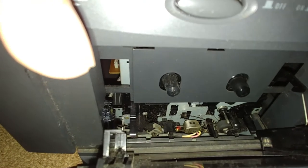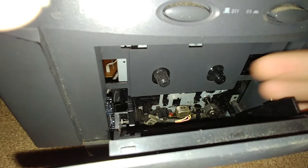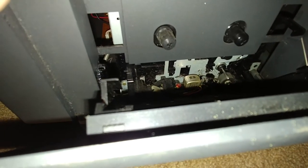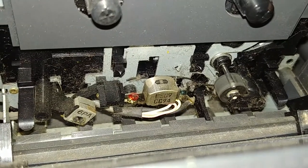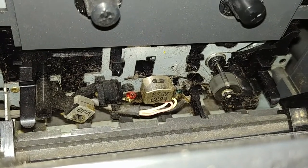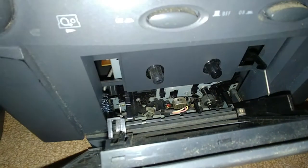Fast forward works. Rewind auto-stop works. Play — alright, good. What's funny is earlier this wasn't spinning, so something must have caught in gear. I don't think the capstan wheel thingy for the pinch roller is secured in place, because earlier I could just push it and it would almost go all the way into the hole it sits in. I don't think there's one of those little locking brackets on it. But yeah, at least I don't have to replace the belt, so that's good.